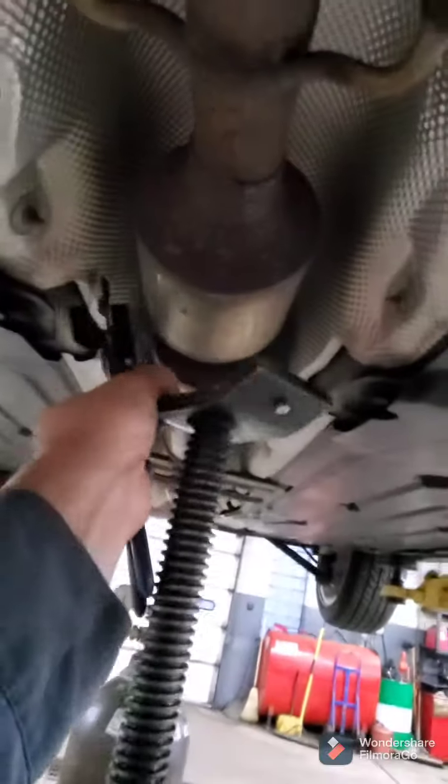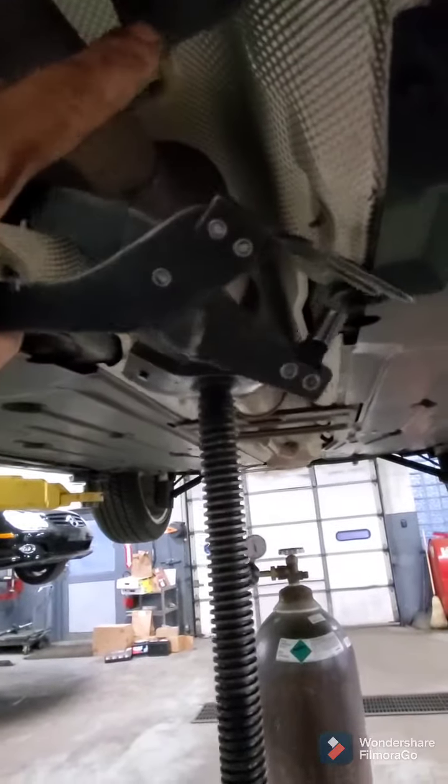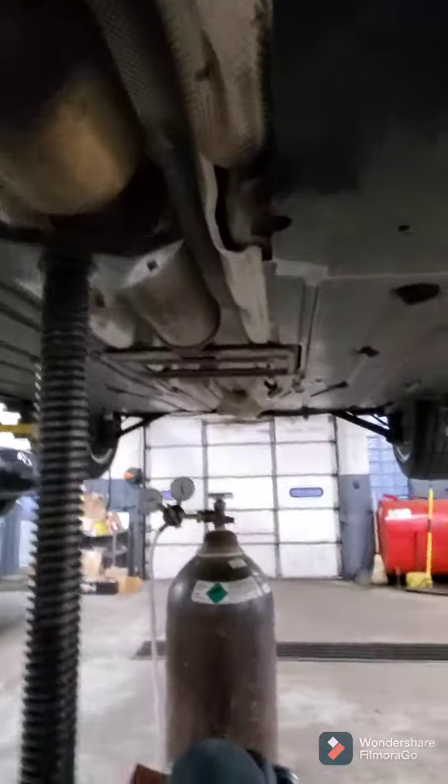Once it's tacked into place, what I like to do is just put the screw jack under one of these mufflers and just drop the mounts down. All you have to do is loosen these two front mounts, and if you want to get it down a little further, do that chassis stiffening plate. Then you can get it low enough where you can work right out in the open and finish the weld.